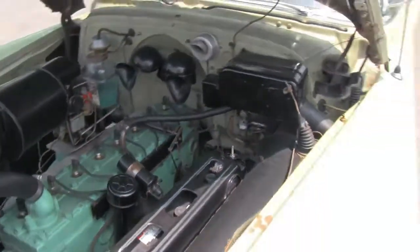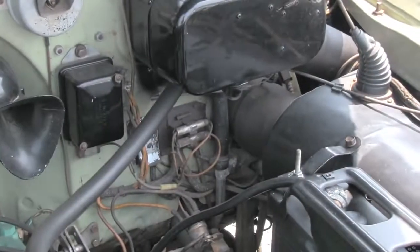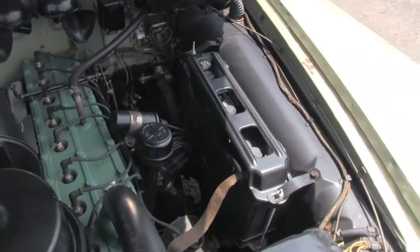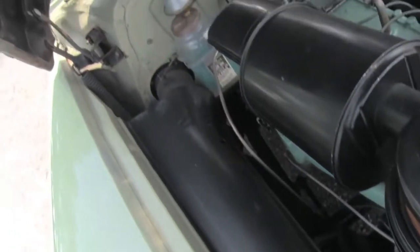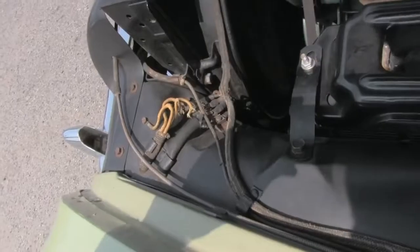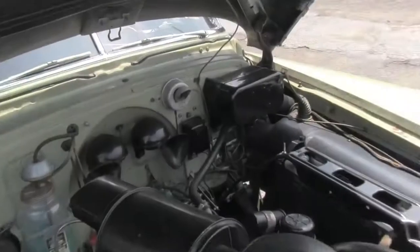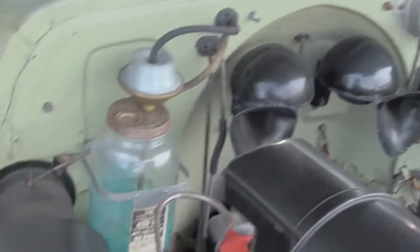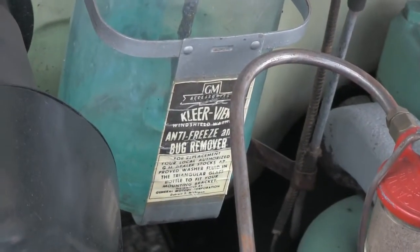While essential drivetrains didn't change from the previous year, compression was increased via new high compression heads to 6.5 to 1. This yielded a total horsepower output of 106 at 3,800 RPM and 194 pound-feet of torque at 2,200 RPM. There were few other changes aside from aiding cooling efficiency and durability. Unfortunately, efficiency with power was never a strong point with the straight 8s. The side valve design limited smooth intake and exhaust gas flow, which really hindered it from high horsepower. They were ultimately outdated by the modern overhead valve V8 in the 1950s.